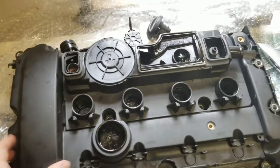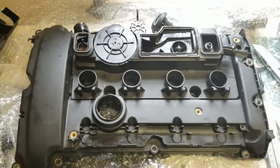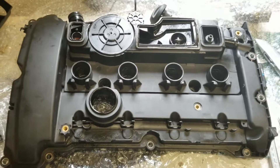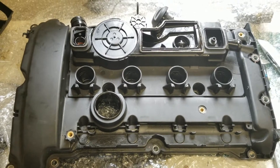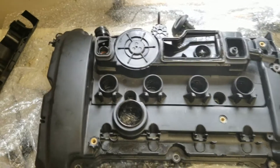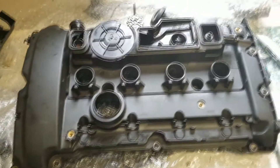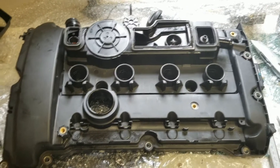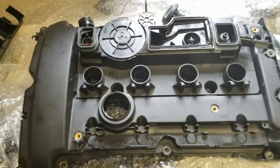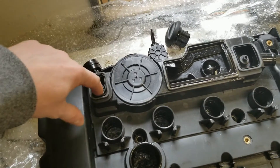This is how the system actually works. Basically there are two conditions. There's vacuum — when the engine is running at a negative intake pressure, meaning the turbo hasn't spooled up enough to produce actual positive pressure into the engine. So the intake manifold is sucking air, and that will come from this pipe that will lift up this little valve here. So this valve here will be lifted up because air is being sucked on this side, and that will draw air from underneath the valve cover.